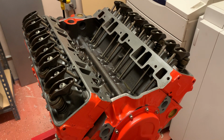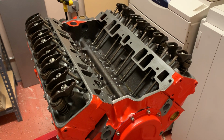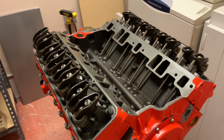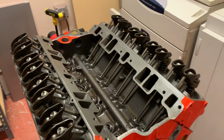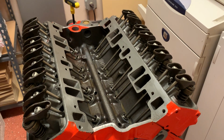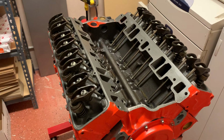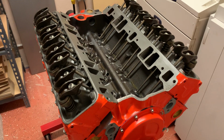I actually tested my torque wrench out. Schrodinger's Box, another YouTube channel, showed how he tests his torque wrench, and I did the exact same thing, and it was pretty accurate. So I was pretty confident that that worked out. The bolts that I had bought had a thread sealer on them already, but I added just a touch, just to give me that little bit of lubricant feel as it was going down into the threads.